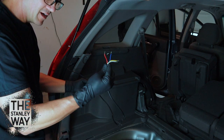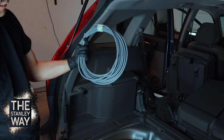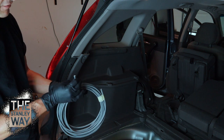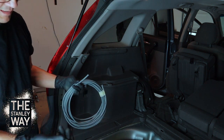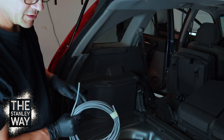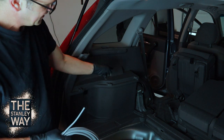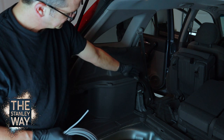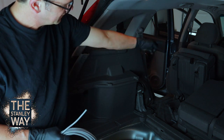Here's the flasher with the wires exposed. I went ahead and ordered a 20-foot section to make sure I had enough wire from StrobesNMore, and I'm going to solder all this wire straight up to it. All I'm going to do is run this wire inside here along the bottom where the plastic molding meets the carpet all the way to the front of the car.